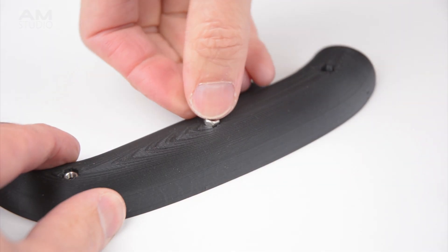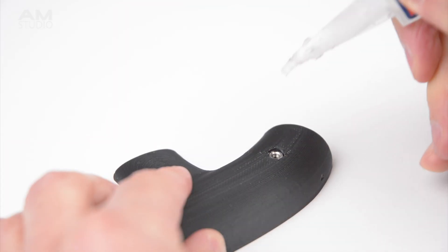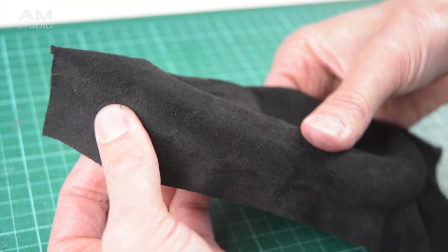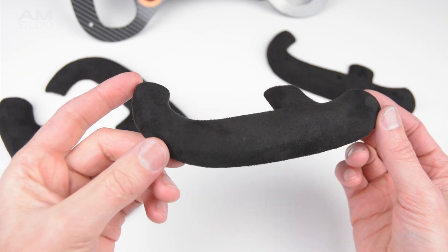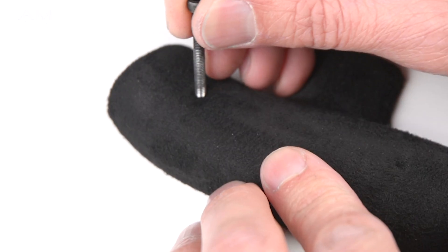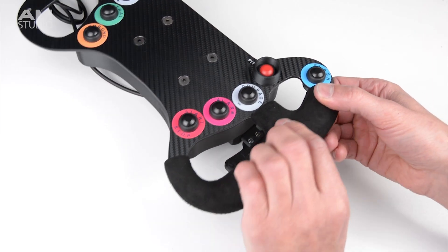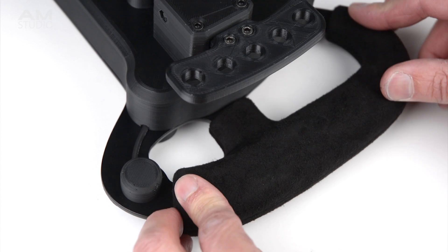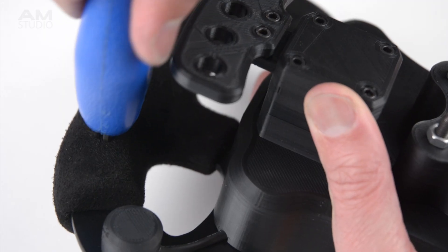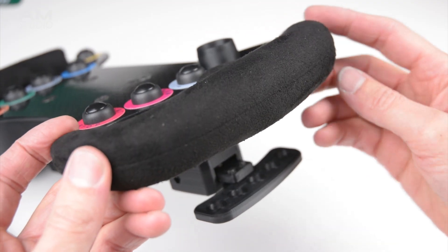If covered with suede, the front handles have nuts pre-installed and a small drop of superglue is used to keep them in place. Then glue is applied to the handles and the suede is carefully shaped and trimmed around the handle. Once the handles are covered, a small hole is made on the back handles for the bolts to pass through. The front and back handles are installed to the steering wheel and the three bolts from the back are tightened. With the handles installed we have a nice clean edge that almost disappears into the suede.